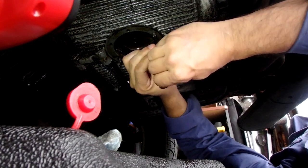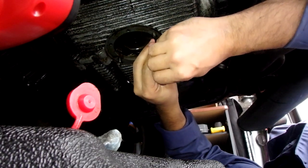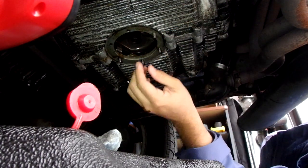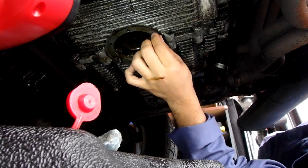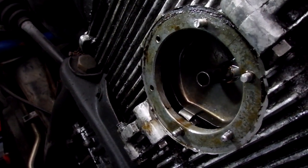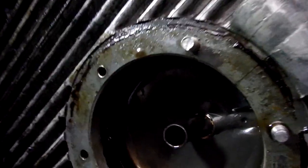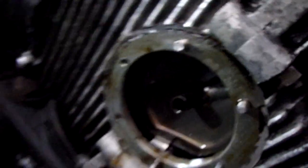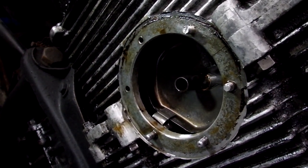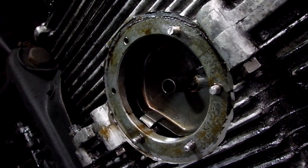Crisis averted — that's a great thing! Nice and simple trick, very easy, and it'll save you a ton of money compared to trying to have someone else do this for you. That's about right — it's about where we want it, so we're good there. There is the stud pulled out — you can see the length we got on it, and I just put a nice little slit right in there to fit my flat head. Easily done, and we're ready to finish this oil change and get the gaskets on, the plate on, and finish it up. Easy trick for how to pull out a stud that gets too far up into the motor.